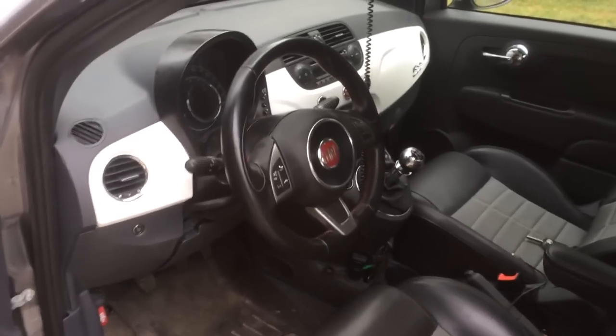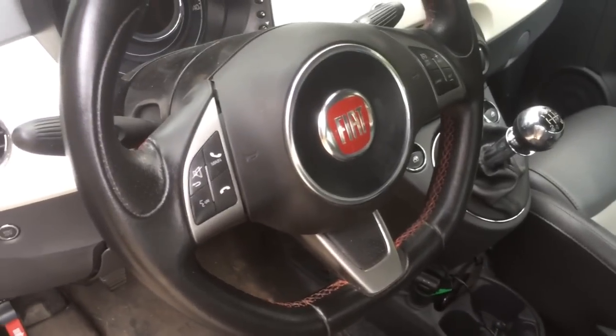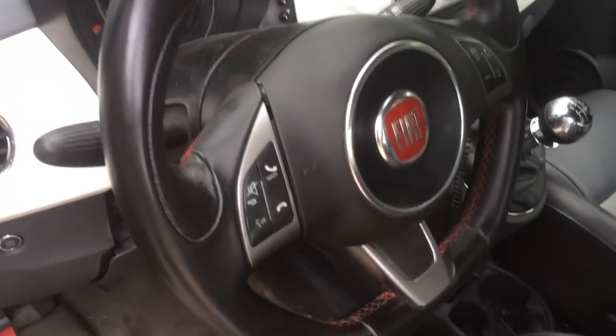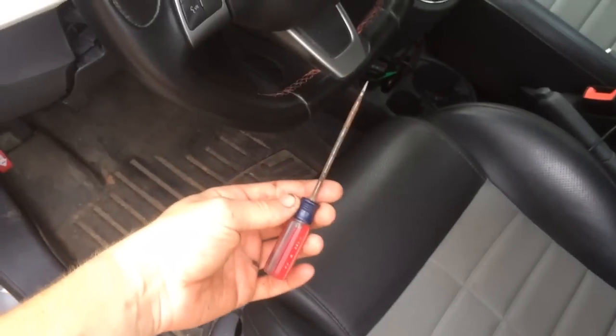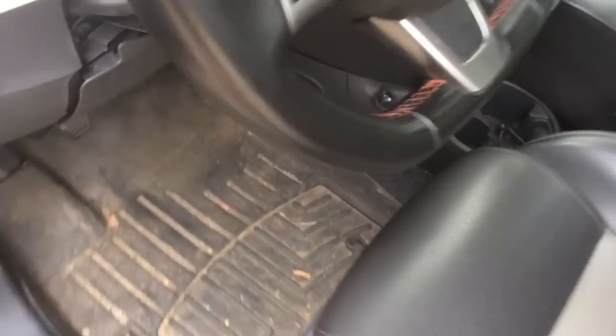The next step is actually the airbag itself. This airbag is held in with two metal — they're very hard to describe — but basically pressure tension clips. In order to remove that, you're going to need a very small flat blade screwdriver. There are specialty tools for this if you have them, great. There's a hole inside of the steering wheel down here which is incredibly difficult to focus on. You're going to stick the screwdriver straight in the side of that, and while doing so, you're going to feel around for that metal clip.